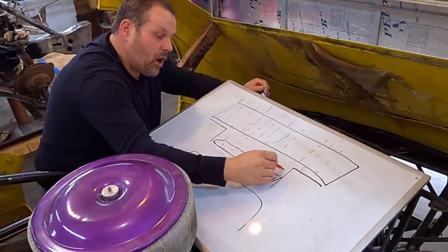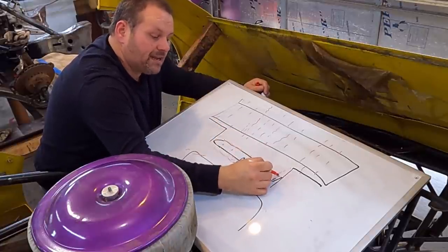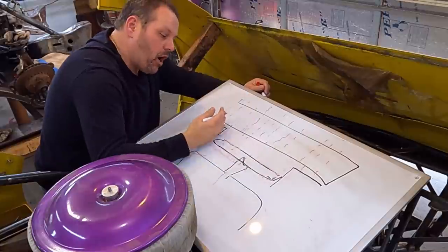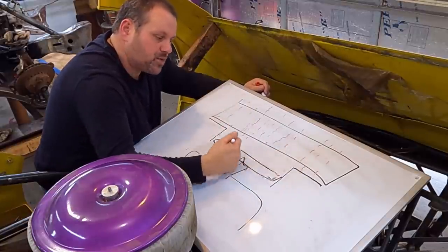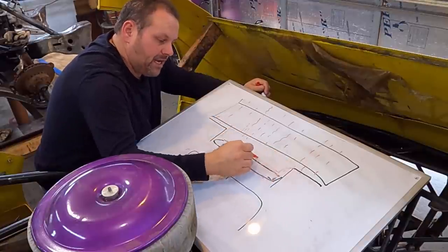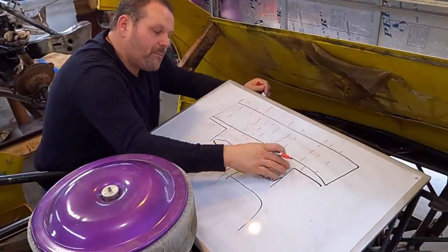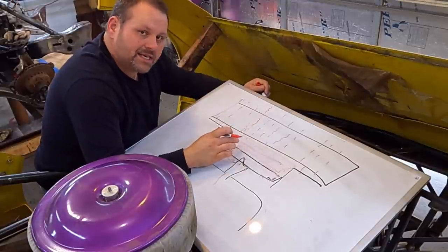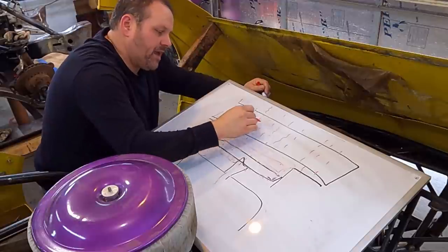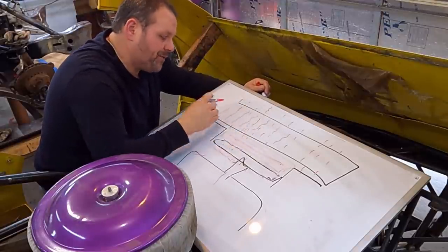And so now you have this low pressure front, but instead of this low pressure front just being right in front of the blade, you've quarantined off this area in front of the fan between it and the radiator. So now you've made this entire area right here a low pressure system. So this is low pressure right here. Well, if you've made all of that low pressure, where is it going to get the air from? Well, it's going to start pulling it through every vent through that radiator. Not just the ones in front of the fan, it's going to pull them through all of them.